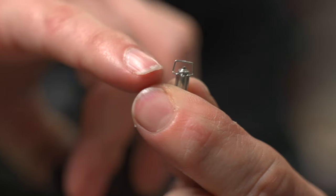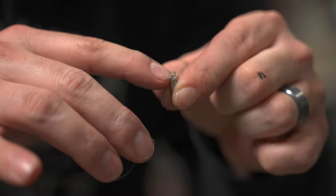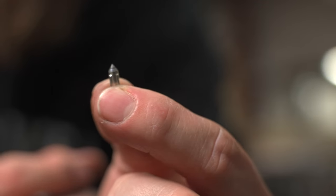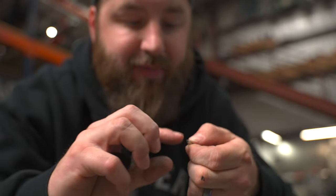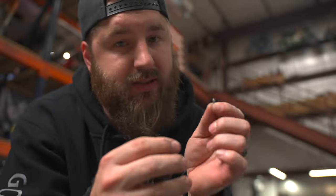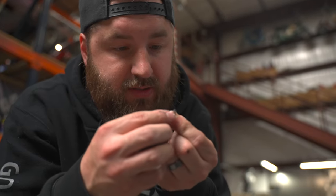So that's the thing that was stuck. This little hoop fits over this little bracket here — that's to keep it from falling off. The little piece on top is spring loaded — you always want to check that. If this ever gets stiff, this needle is bad, even if the tip is still good. You can kind of see on this tip there's a black little groove where it was stuck in the brass. I like to just use my finger and kind of wipe it off. Even though there's a groove on it, you shouldn't have any issues. But if you can actually physically see a groove in it, it's not going to be any good. In this case it's just a little sticky, so I'm just going to clean it off a little bit and it's good to go.